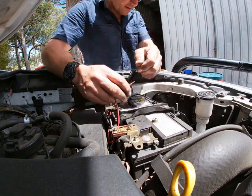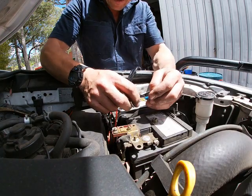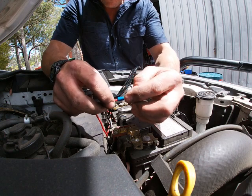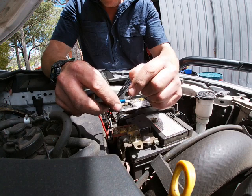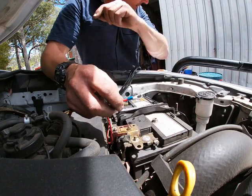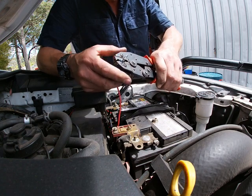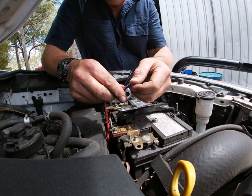You can see once you get into this a bit, you know, it doesn't take all day. There's that fitting. I'm just trying to capture all the, okay, that's pretty good. I want to make sure that all the wires are up inside, so just give a little twist as I put it on. You don't really want too much hanging out the front, but that's okay, but you want to make sure that it's captured at the back, that there's no wires hanging out the back, do you know what I mean? And crimp. Beautiful. Heat shrink.